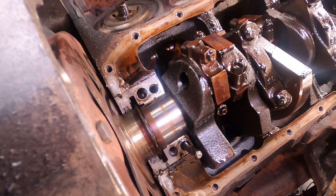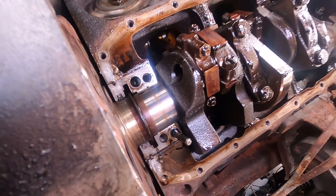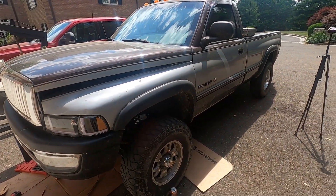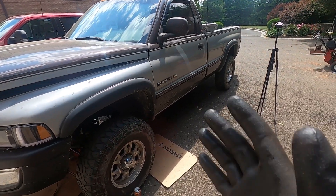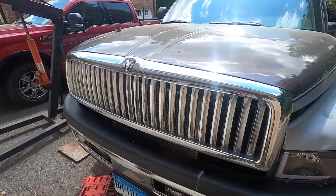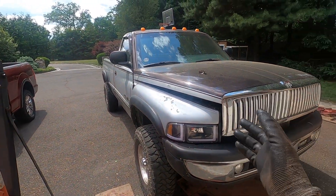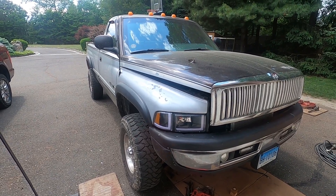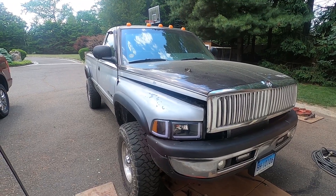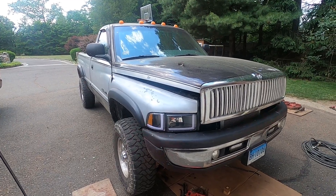The main journal looks great. The surface where the rear main seal rides also looks good. I'm going to put a new rear main seal in it because I think the old one is leaking — that or the oil pan gasket was leaking. For the repair — what can you do in this situation? Well, you can do the perfect thing and rebuild the motor. At the end of the day, metal shavings are in the engine, and the only way to get rid of every last one and make it perfect is to tear the whole motor down and clean out every single passage by hand.